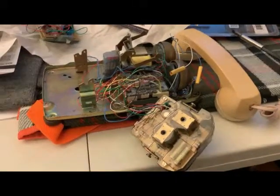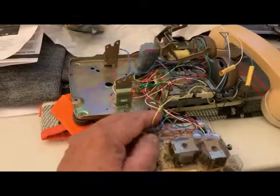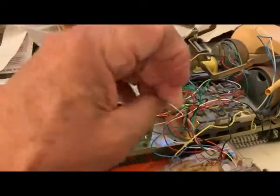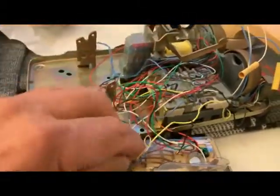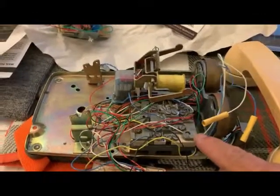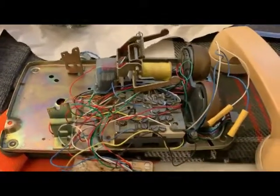What we're going to do now is walk through how to replace the wiring, because there are different wires. There are two wires on this thing that don't come on the new one: a reticulated blue wire and a white wire. I recommend you take snapshots before you do anything — capture with your cell phone or a camera exactly where the existing wires are, just in case you need to fall back.